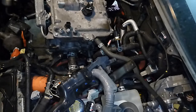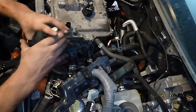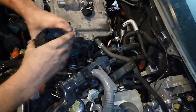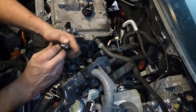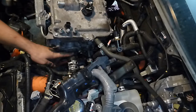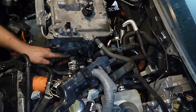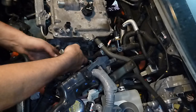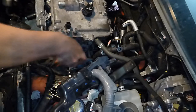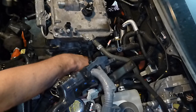Now we're going to have to give a little more attention to this area here, because it's got to get cleaned up. Alright, these hose clamps - they're going. I'm going to put it over here, I'm going to put this one over here, and then this whole pipe is going to come out. That's going to break free from here. And then this pipe here goes to the heater core. So we're going to pull that back. Keep the clamp on the hose, because when we put it all back together we're going to need that.